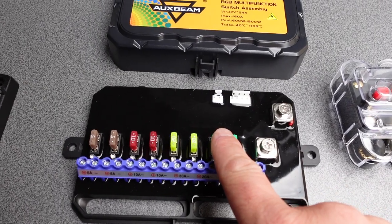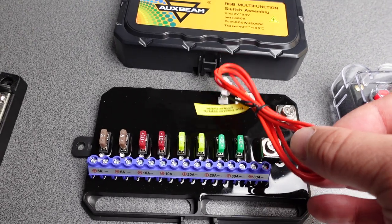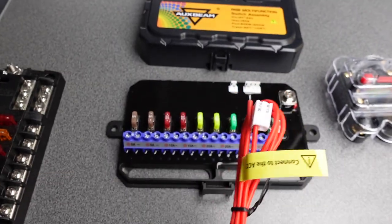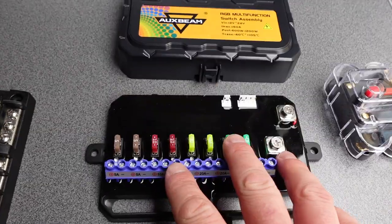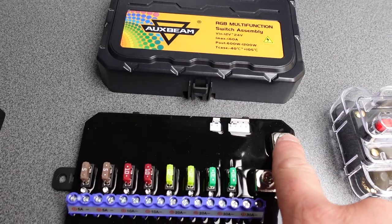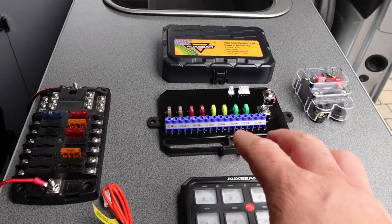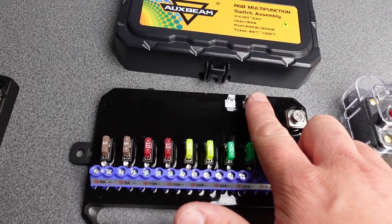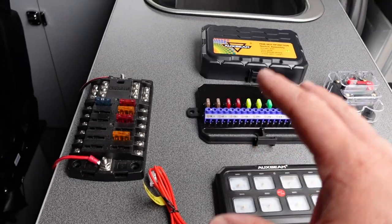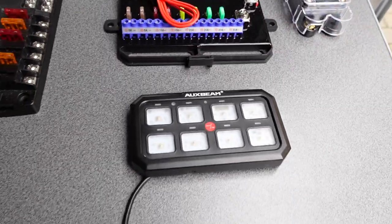This is designed optionally to come on when your engine is running — there's an ignition wire that clicks in and you take that to wherever your item gets its electrical feed. Because I'm using it in the camper van and want it always on, I put that straight onto the battery feed, so as long as my lithium leisure battery has power this will be live. Then your data cable simply clicks in one end and into the other side of the panel, and you're done.